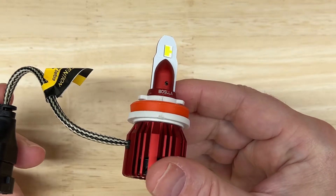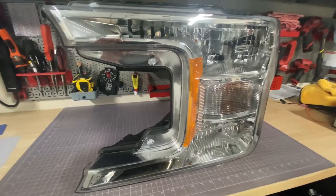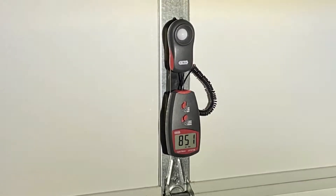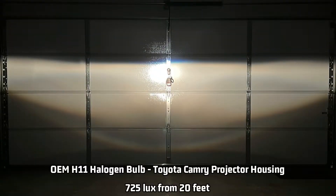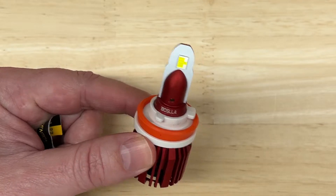Here's how I do my LED headlight testing. For projector testing, I made a test rig using a 2017 Toyota Camry H11 headlight projector. For reflector testing, I use an H11 headlight from a 2018 Ford F-150. I use these specifically because they are among the best-selling vehicles in America for over 20 years and are the most common on the road. I'll power the lights using a benchtop power supply and position the light's hot spot onto a lux meter 20 feet away mounted on my garage door. I'll record the initial brightness and then again after 27 minutes to document how well the light manages heat — 27 minutes being the average commute time in the United States. My tests aren't for lux number accuracy, but for comparison to a stock H11 halogen bulb, which measures 725 projected lux and 910 reflected lux using my test method. Different tests in different environments will give you different results. If you want to do the same tests yourself, I list all of the equipment I use in the description. It's important that you check the description for an important note on aiming your headlights, how to ensure you've picked the right headlight for your application, and the legality of replacing halogen headlight bulbs with LEDs.